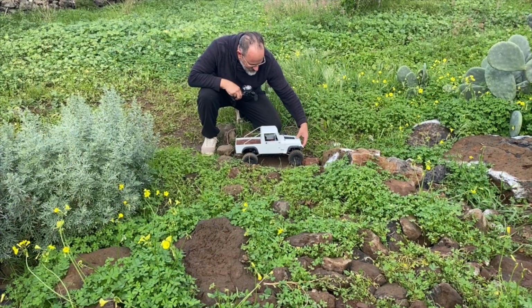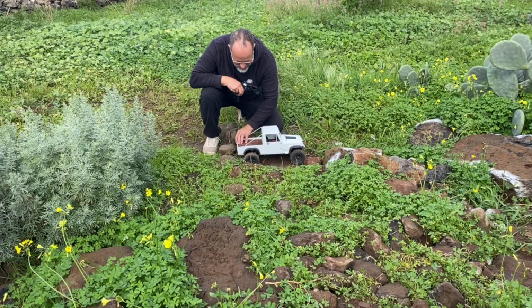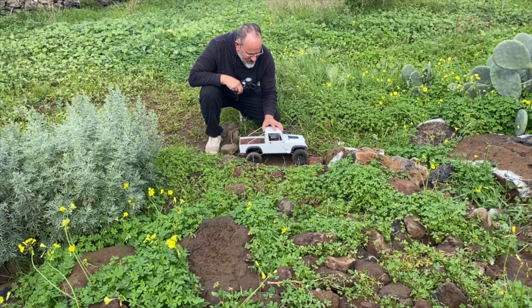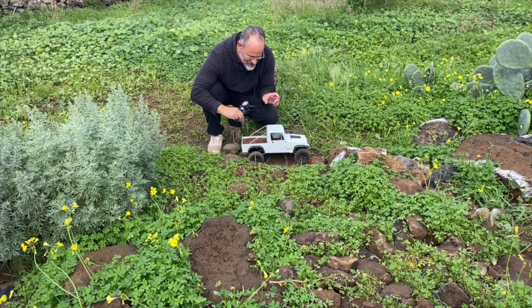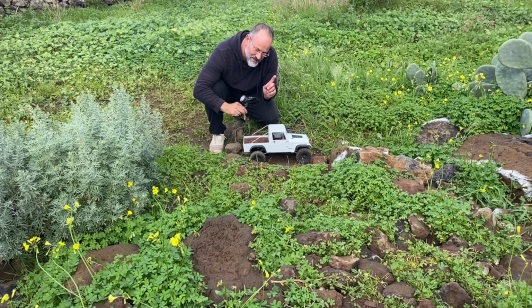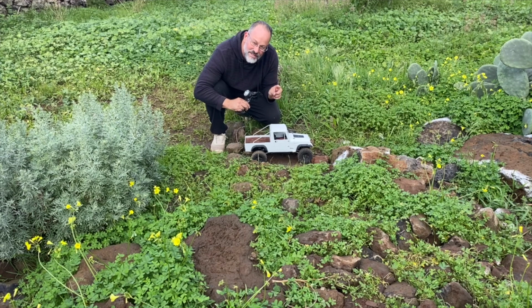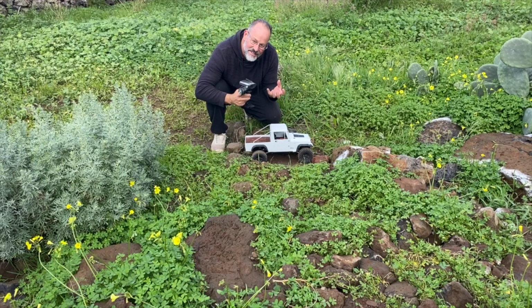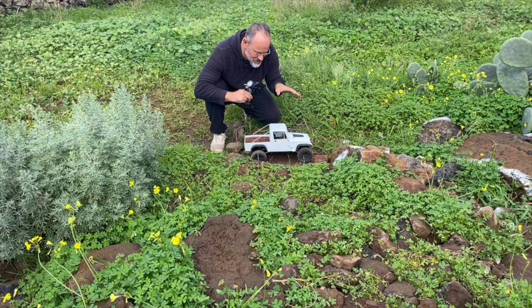And it's time for the scrambler. As you can see, the scrambler does have a little bit of suspension left in it, but I can afford to have the suspension a little bit higher because my skid plate is slanted, in the sense of, first of all, it's tucked up, and second of all, the back links are higher than normal, 2 centimeters higher than normal. The front links are 1 centimeter higher than normal, and everything is tucked in a little bit higher, forcing the nose of the truck to stay down on the obstacle.